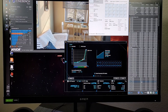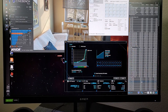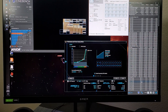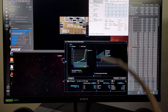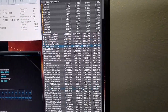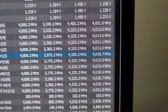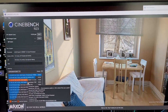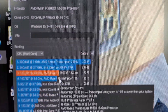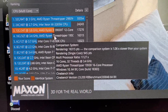The 3900 XT has a base clock of 3.8GHz, and right now it's hovering around 4GHz for this entire Cinebench R23 run — no thermal throttling whatsoever. The temps are good enough to sustain 4GHz throughout, and because temperatures are favorable, the boost clock has one core reaching 4.5GHz. Our Cinebench R23 benchmark finished with a score of 17,276 — really good, actually beating out a Threadripper 1950X.